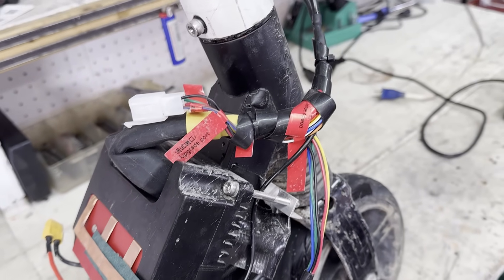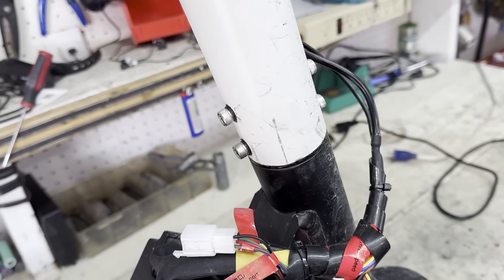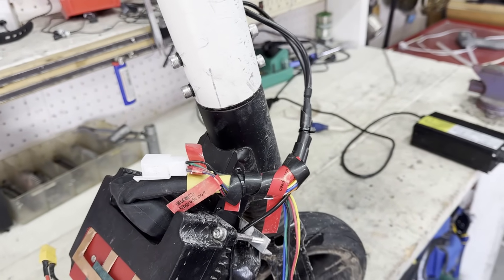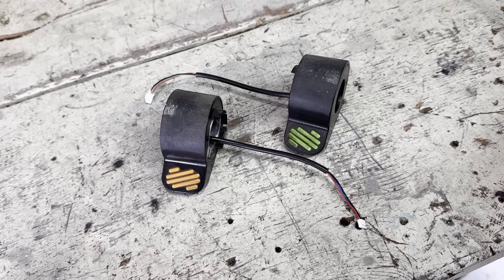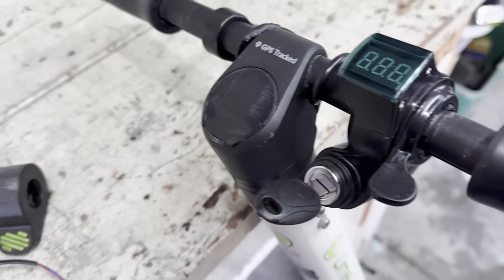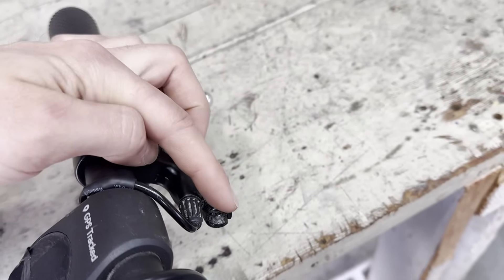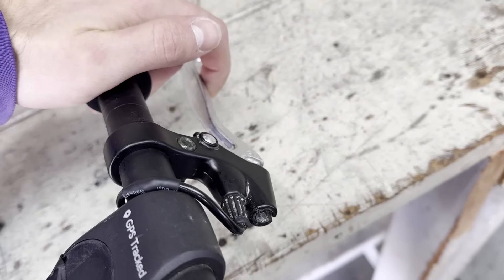I also finished all the smaller wires. A tip when soldering wires on something like this with a joint that turns: you want to turn it all the way so it's as tight as possible, and then solder the wires to make sure you have a lot of slack. The stock throttle and regen are super worn out, plus I need an ignition and a voltmeter, so I put on my favorite thumb throttle, ignition, and voltmeter combo. I also want to be able to control the regen, so I took a brake lever with no brake line but with a switch in it, so I can just push it and get some regen.